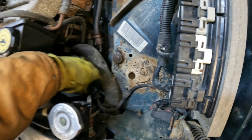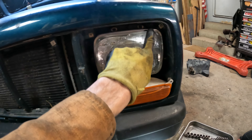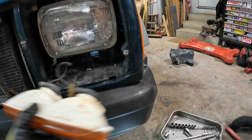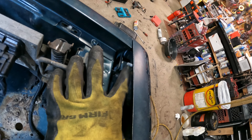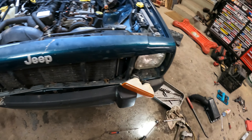I can also get to the power steering lines and the radiator hose to drain the coolant. There are two screws here to remove the bezel, a couple screws, this light comes out, there's a bolt down here and a bolt up here in the corner, and then there are a couple bolts along the front. Remove those and this front end assembly will come off.